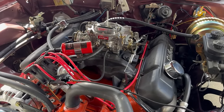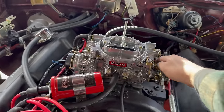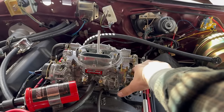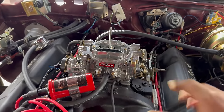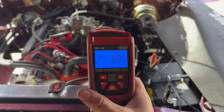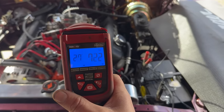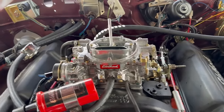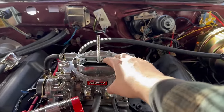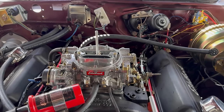Yeah, it's never coming off a cold idle. Even though I can feel the choke stove is hot, it's not doing anything. So I bet the spring is installed wrong in there, and all we have is the vacuum pull off. Even idling down at 700, it still reads 27 degrees. I did verify this timing mark as being correct, just by the way. Here's problem number one. Notice our vacuum pistons are fluttering up and down at a low idle. That means our springs are too strong, and that's not super surprising.